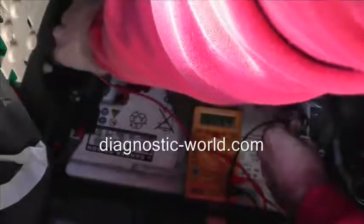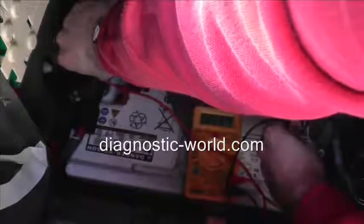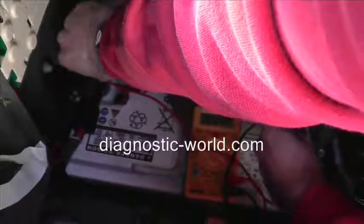As you can see, we have a reading of 11.39 volts. That actually ties in with what we believed, because the battery warning light is showing on the dashboard. We already had an idea that the battery needed to be changed, and this multimeter is basically giving us full confirmation that it does in fact need to be changed. So we'll change the battery over and that will cure the dashboard light problem. Thanks for watching this Diagnostic World video.